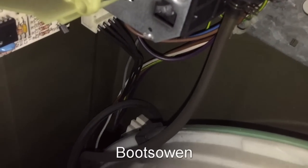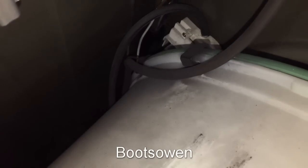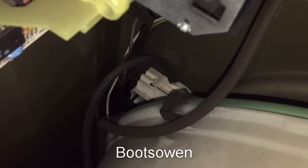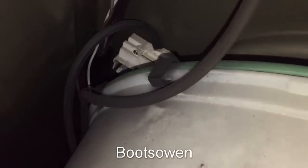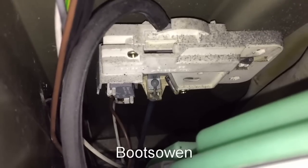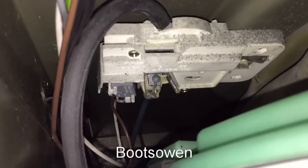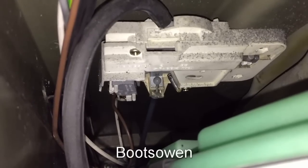Any views in there? Not much to say, just some cabling. The door interlock's down there. The pressure switch is up here on top, but there's a pressure bottle down at the bottom of that hose. The door interlock also seems to be connected to something via a black hose. I don't know what that is, because at the bottom of the door interlock you can see that cable — that goes to the motor.